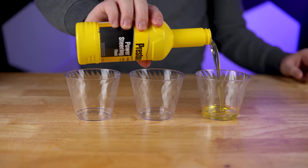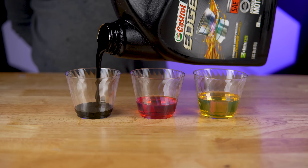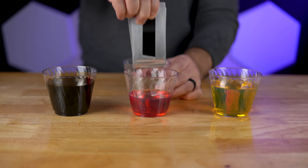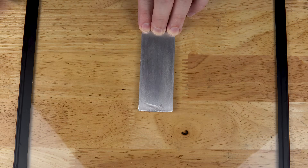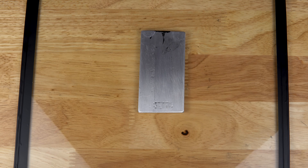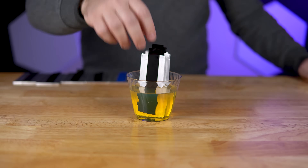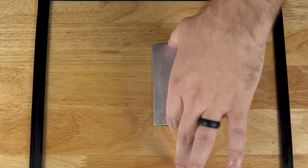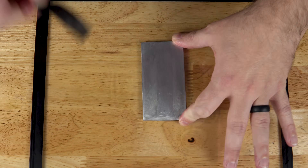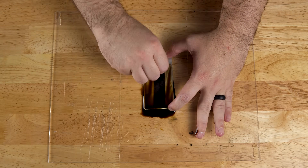Lastly, we tested each tape's resistance to common chemicals found in a car engine bay, such as power steering fluid, engine degreaser, and used motor oil. After soaking samples for 15 minutes in engine degreaser, most tapes seemed unfazed — until 3M 1700, which appeared to start degrading. Super 33 and Extreme Weather also did not fare well, but Tessa performed exceptionally. All tapes performed very well with power steering fluid. For used motor oil, samples were soaked for 7 days outside, and all tapes appeared unaffected.